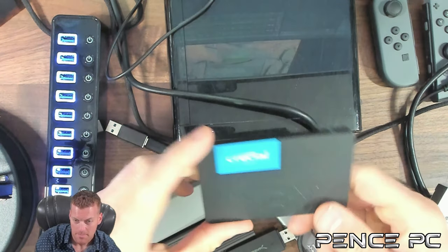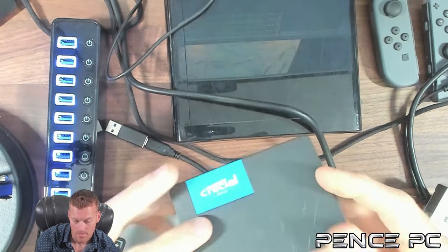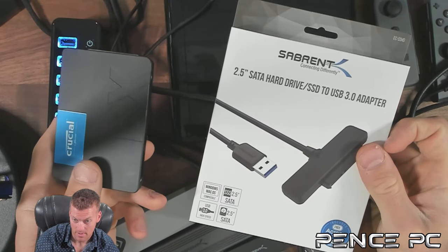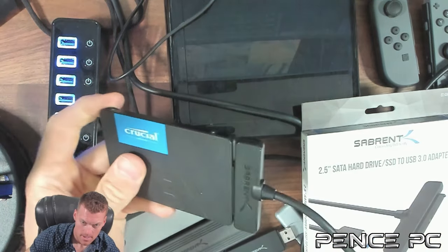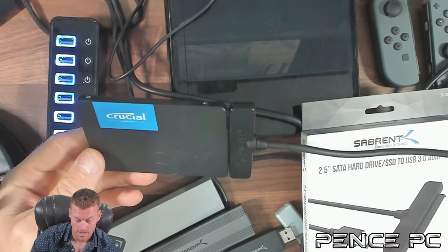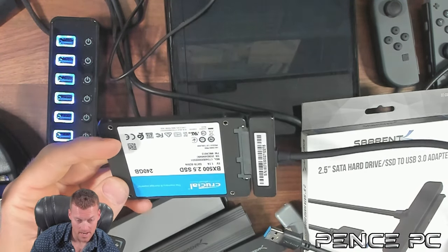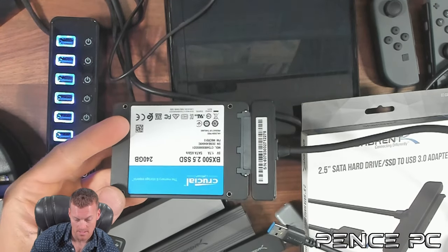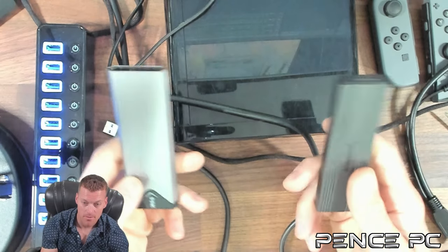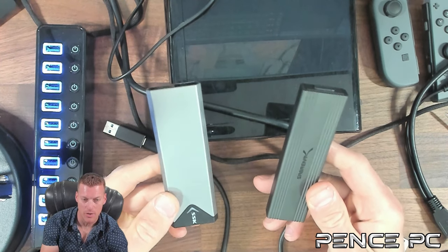One of the best options is a solid state drive. It uses very little power, so you don't need a dual USB cable — just use an SSD to USB 3.0 adapter, plug it in, and connect to your Wii U. It works great and draws very little power, giving you the best speed available, although you're limited by the Wii U's slow USB interface. Another good option is an M.2 drive in a USB enclosure. There are two different types of M.2 drives, so you need to be careful.